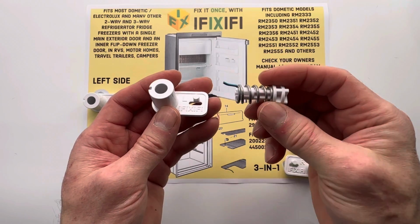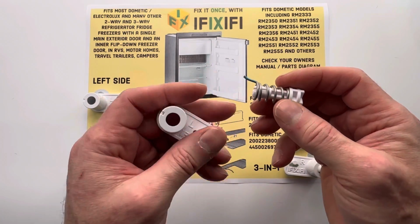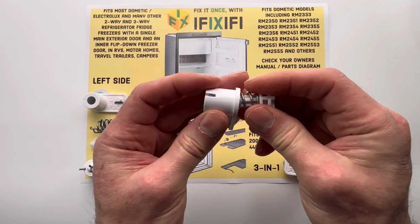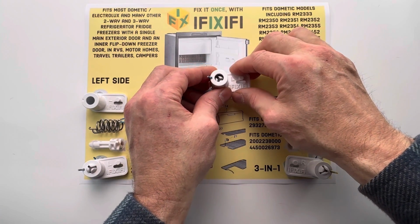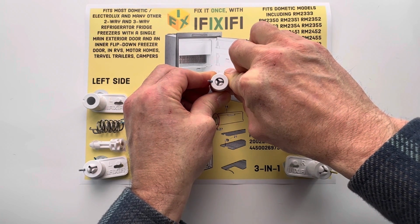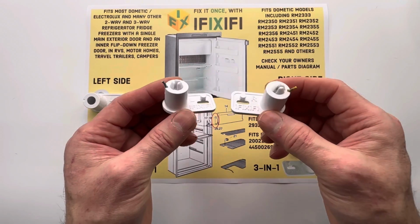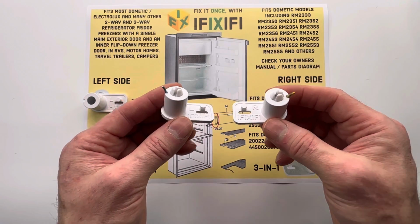Next, insert the bolt and spring into the matching spring housing so that the thumb of the spring pokes out through the slot in the barrel of the spring housing. Last, place the assembly on a flat surface and push down until the 3 prongs of the bolt lock into place in the hole in the top of the barrel of the spring housing. Now you're ready to reinstall your freezer door using the instructions in the videos that we've linked to in the description below.